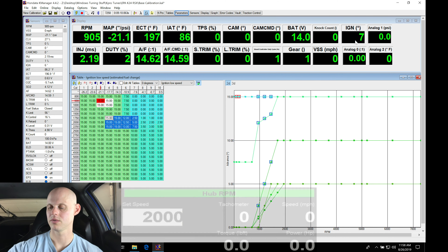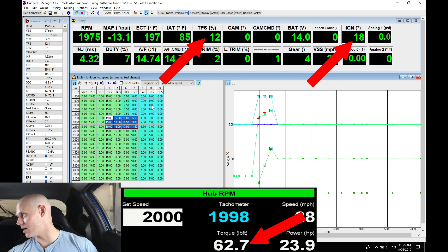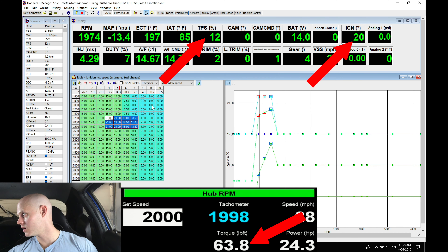If I open my throttle up a little bit more, it's going to be showing me more torque production and I can't actually measure the cause and effect by changing the spark timing. It's going to be important that I'm holding my foot fixed. You're actually going to be able to see — I'll have a pointer on screen going to the throttle percent, a pointer looking at our ignition timing, and we can see it changing along with the live torque output.